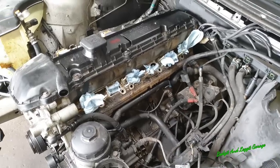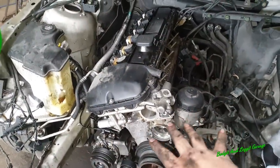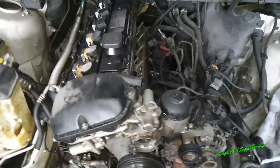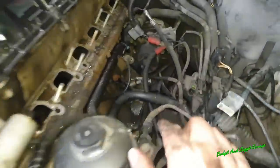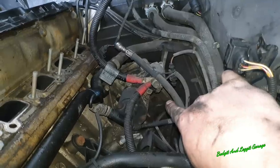It only takes a few seconds and it can save your engine. Right, the next thing we're going to do before we move the Vanos system, don't do anything with that yet. We need to take the exhaust manifold off, which is awkward enough. The reason I don't like taking that off is I like to get the engine to top dead center. You can see just underneath the starter motor, there's a big hole there for the locking pin to go in.